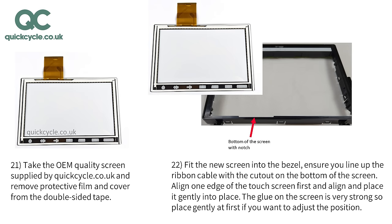Place the metal retaining frame back into place. Before placing the screen back in, clean the back side of the touchscreen to ensure there are no visible dust or dirt particles, as these will be stuck inside. After fitting the LCD screen, visually inspect to ensure there is no dust or dirt trapped between the screens. Remove the LCD and clean again as necessary. The next steps can be completed in reverse order of this instruction, but specific care needs to be taken when reinstalling the ribbon cables. Please refer to the PDF supplied with your screen from QuickCycle to ensure these critical steps are carried out correctly.